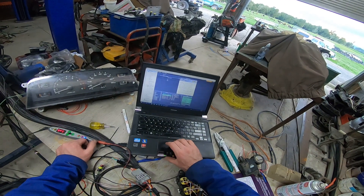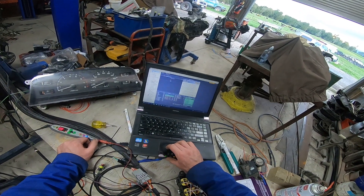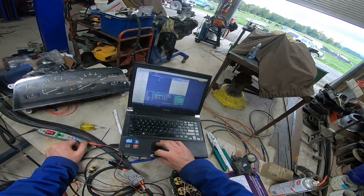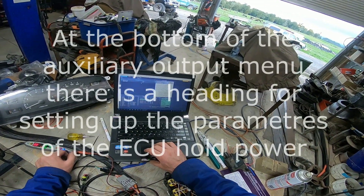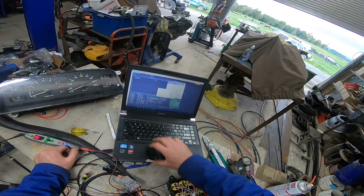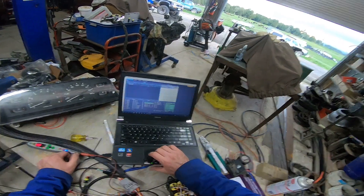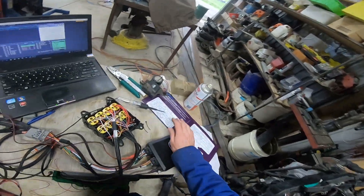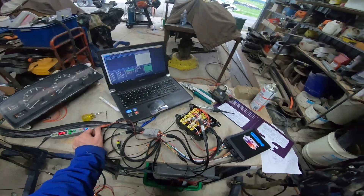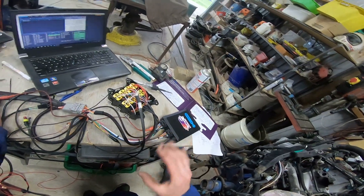You then need to give it some settings — tell the ECU how long you want it to stay on. In the auxiliary options table you've got ECU hold power. Click on there, then time to keep alive. I had it on five seconds; I'm going to change that to four seconds because the stepper was sitting fine. This ECU isn't currently communicating with the laptop so it'll bring up a little warning when I turn it on.